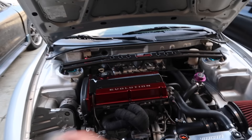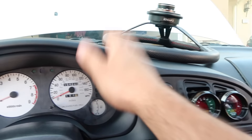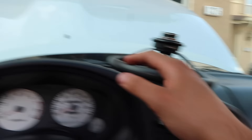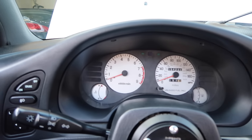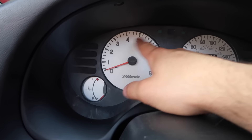When you're out there looking for a car, do not believe anything the previous owner is telling you — they're obviously trying to sell it. You also want to check for oil leaks. As you can see, we have oil leaks everywhere. It's very common for the DSM to leak from places such as the rear main seal and valve cover, just miscellaneous parts — they're super old cars.